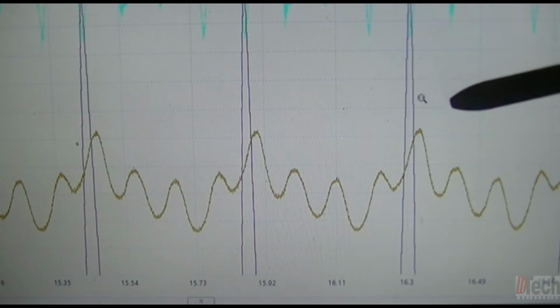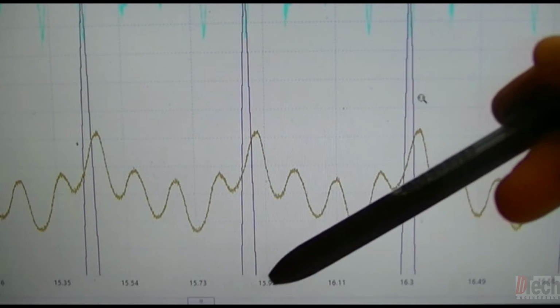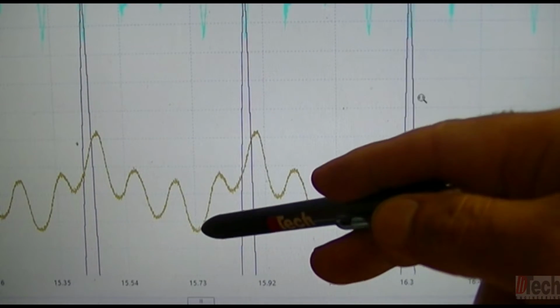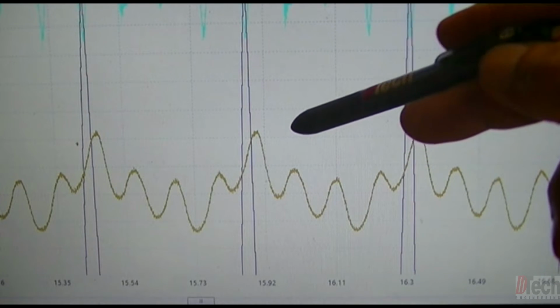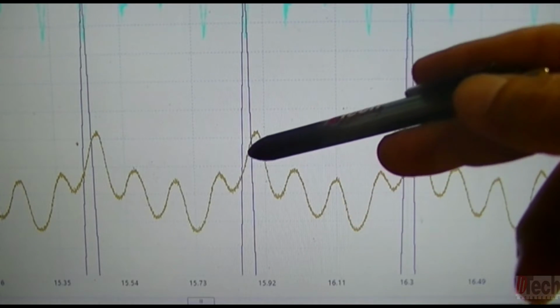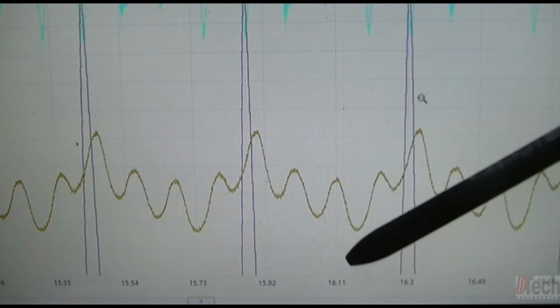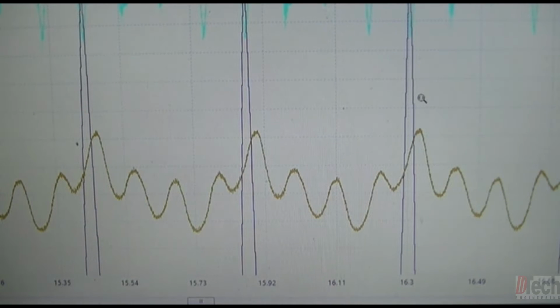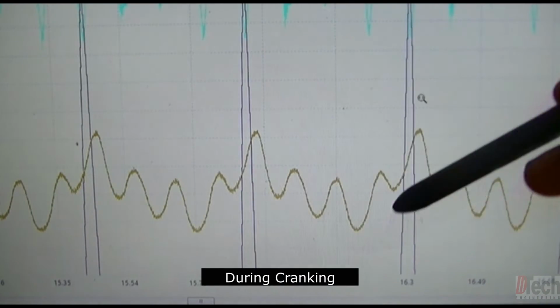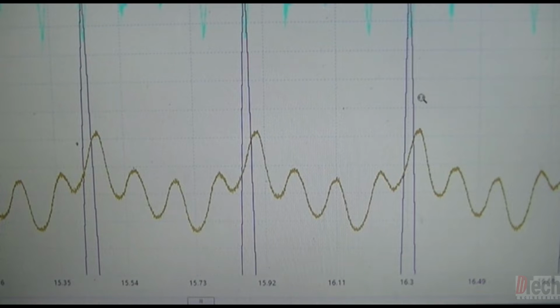I've shown videos on that on previous repairs to prove that out. Also, something that can cause a rise is a delay of intake pulls, which will let the pressure rise until there's a pull occurring. That can cause an anomaly like this, which again, I do have other videos that prove that out. And also a slowdown in RPM in a dead hole can create anomalies in the intake trace as well.